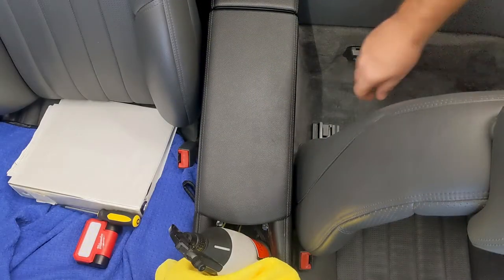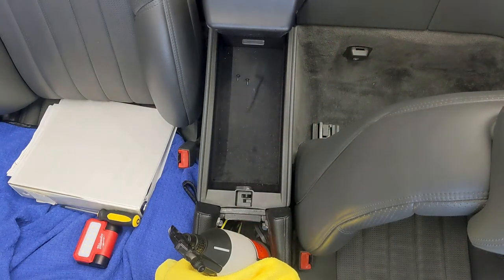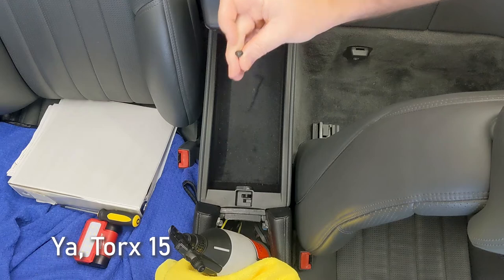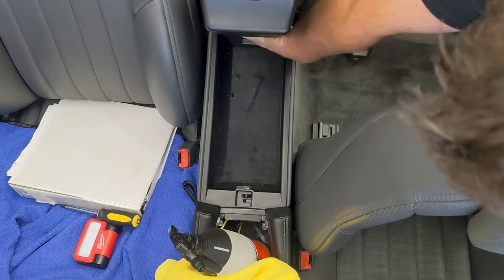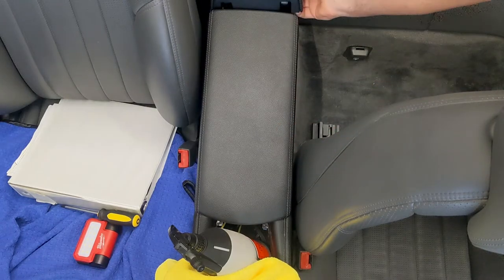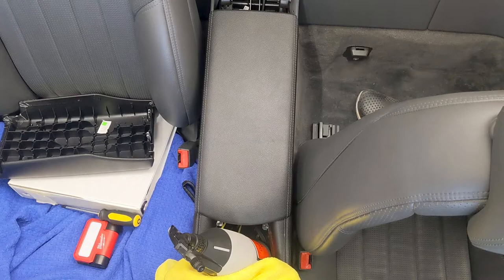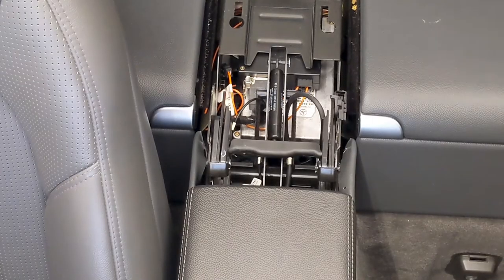We have lost grip. What you need to do — let's see if we can see in here — there are two little screws that I've already removed. These are probably T15s, maybe T10s here. Pop those out from right here, and what that will do is release this little magic piece here. Just tilt that out and reveal these beautiful little gas struts. So this is a gas strut.